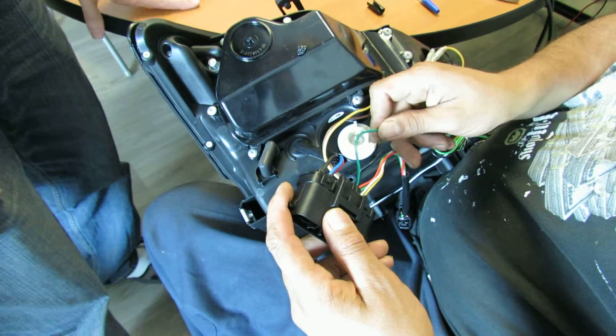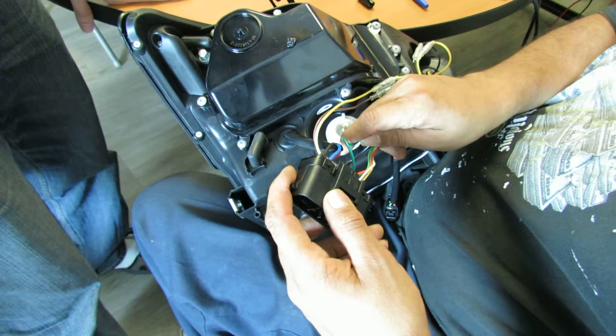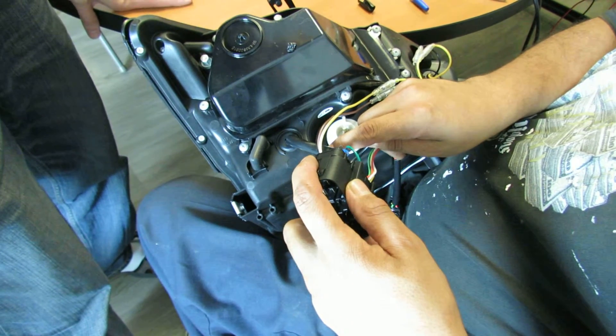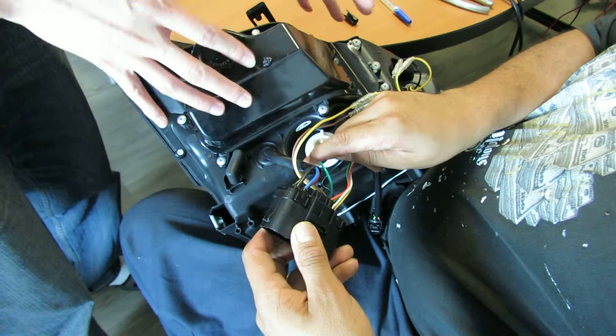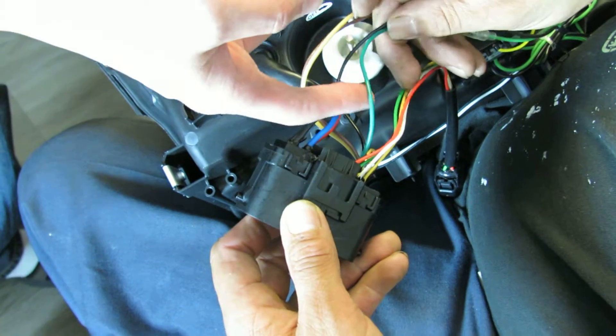Here's a video documentation to show you a little bit of concern that you have. It seems that you do not have a particular wire or pin that actually powers the LED strip. So we are showing you in this particular connector of the new headlight — this green wire at the back is actually designated to power the LED strip.